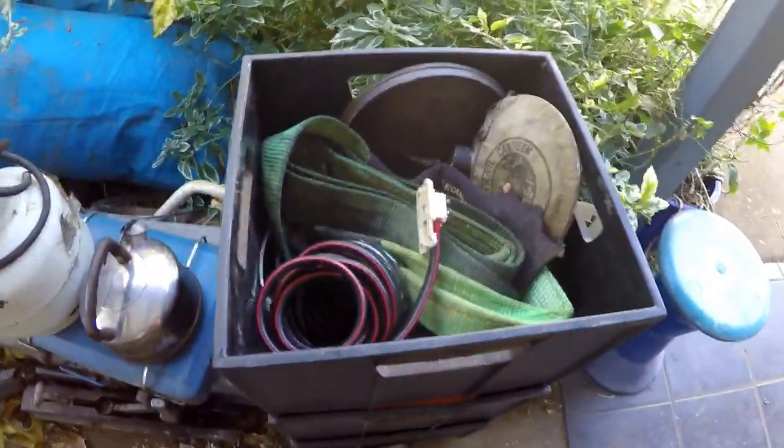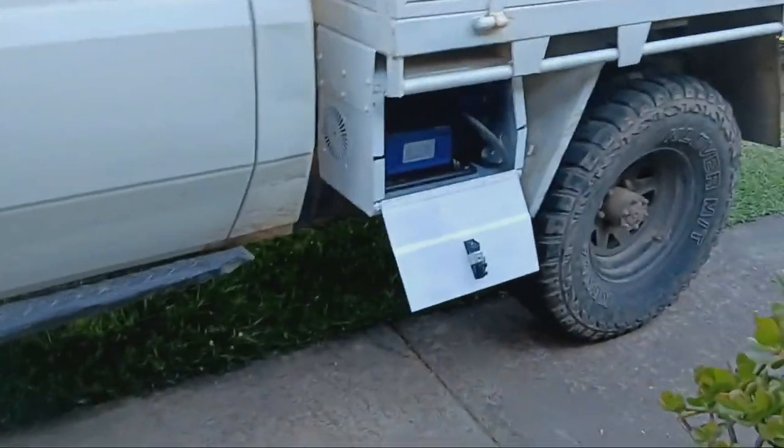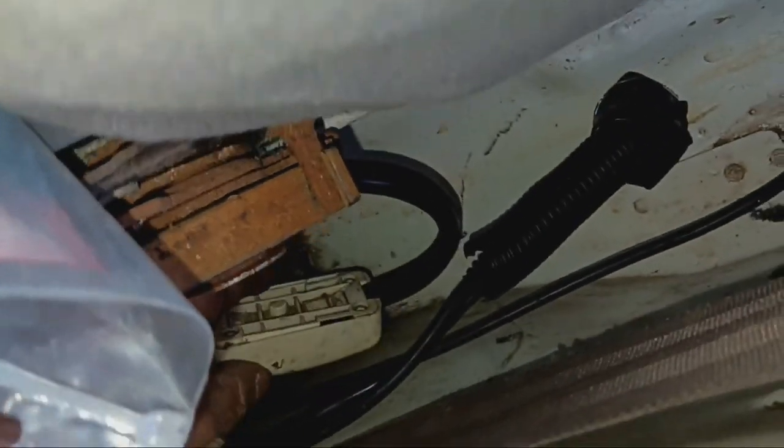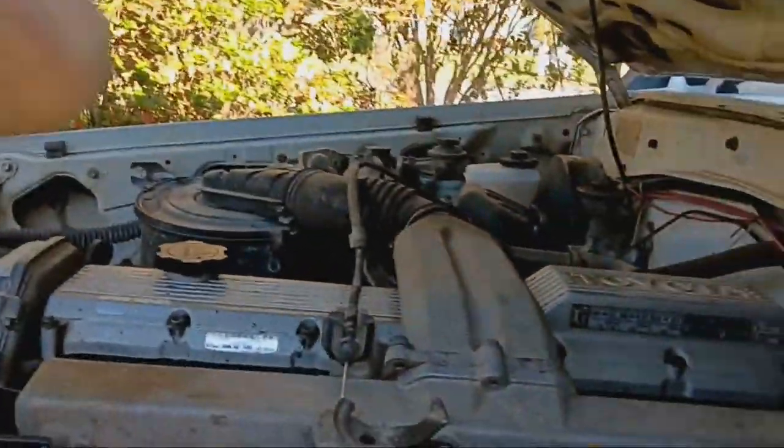All I need is a 100 amp fuse and some terminals. I've got it all in. The wires go up there, and out there and through there and into the cab. I could have run along the chassis but I had to join it — I just got this joiner thing. I joined it there. Got plenty of lead. It goes under the carpet. It's better to have too much than not enough. And then I thought, well, you've got to have a fuse too. I was having a look at 100 amp fuses — you can get fuse holders and then the fuse.